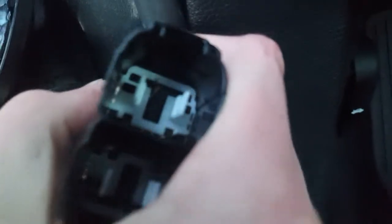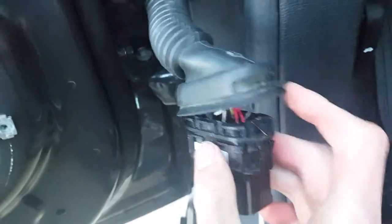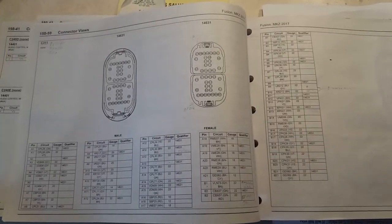I've added it myself, so all I gotta do is get this pin in all the way. After that I gotta get the connector, strip this off and add a connector to it that'll fit into the mirror. I'll have to look at my wiring diagram to find out which of these white pegs I need to remove and stick it in there for the auto-dimming mirror.